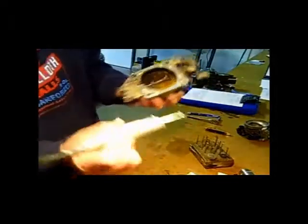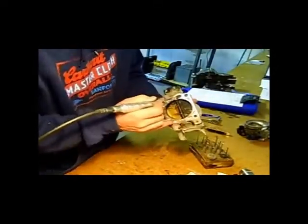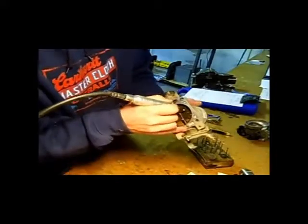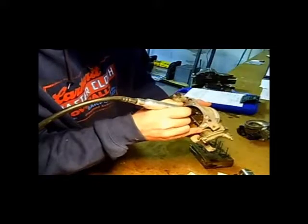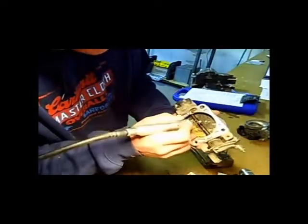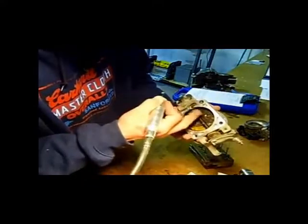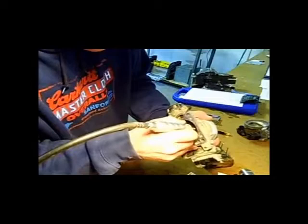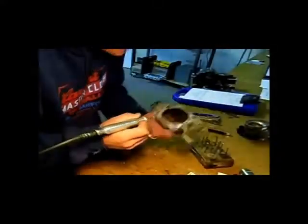As a matter of fact, I'll show you on the dark area so that you can see it more clearly. Okay? So, first, I'm going to lean the bit to the left. I'm just going to go straight up. Okay, I'll lean the bit to the left. And what you get is you get a cut on the left-hand side. Lean it to the right, and you get a cut that goes on the right-hand side. Lean it directly up, and you can see the arc goes directly across. That's how you know you got your angle straight.